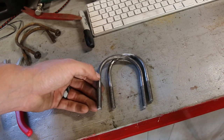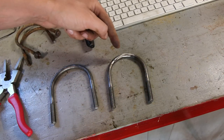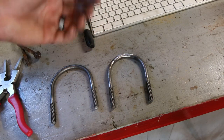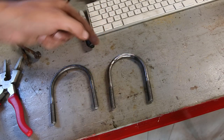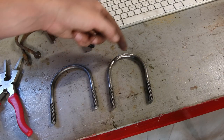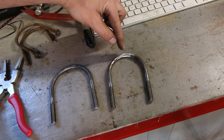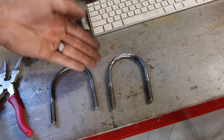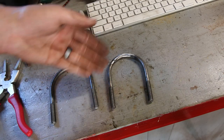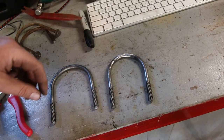I pretty much took out the width of the diameter of the U-bolt. I cut it and tapered — beveled it all the way around so I could fill it all the way in with weld material. I set my wire feed speed really slow and turned the heat up and got it nice and cherry red. You can see I've got a pretty wide heat affected zone for only welding right in this area. Overall I think this is going to last and stand the test of time. I'll throw a little bit of primer on it to keep it from rusting under the car.